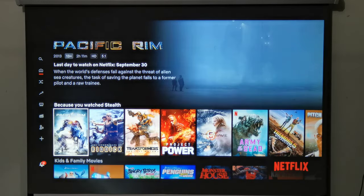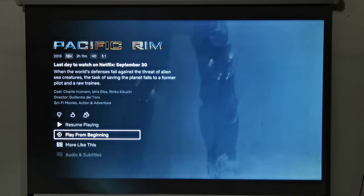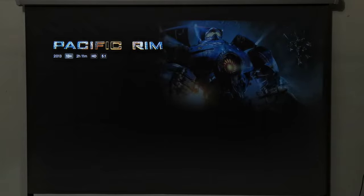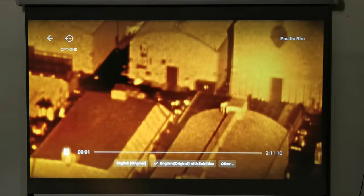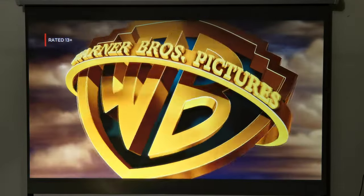For connecting official movie streaming devices such as the Amazon Fire TV Stick or the Google Chromecast, this projector does not have HDCP protection, so these devices will not work as they should when connected via HDMI. You may get video but there will be no audio.